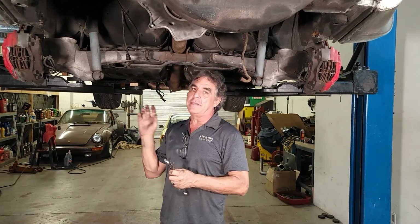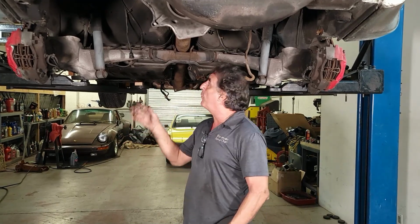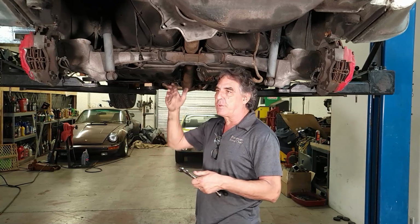You guys didn't watch the whole video, because I did explain that we need to move this car around the shop. I don't want to take all the suspension out, lower the engine and transmission and drivetrain out at one time. But this is a good way to do an individual repair. Like if we had a noisy torque tube, instead of taking everything out, this is how you would just remove the torque tube to repair that. Things like that.